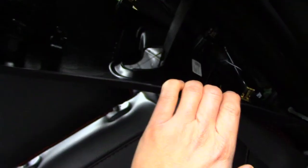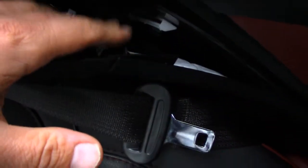Once they're out, you're just gonna want to pull these away from the headliner. I'll show you here in a minute once I get it popped out. There are about four clips — you just need to pull it out. Once your four clips are out, you want to disconnect it here. Once you do that, it's just gonna look like this — just let it hang.